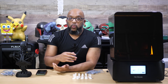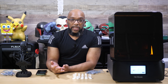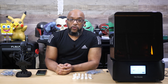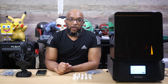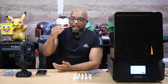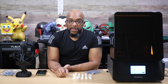Honestly it looks pretty easy — I haven't done it personally, but it's really just a matter of taking out a few screws, disconnecting a ribbon cable, sliding the screen in, and plugging everything back in. There's also a calibration tool you can use with a built-in printer feature to calibrate the screen once you install a new one. I like that even though they came out with a new printer, they did not close off an upgrade path for people who bought an original UltraCraft Reflex, whether that was several months ago or even recently.